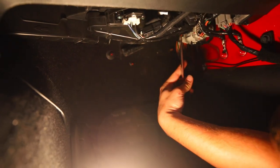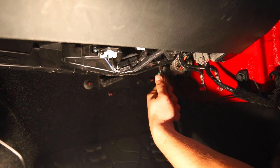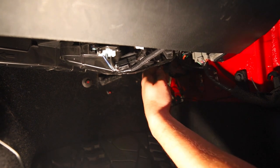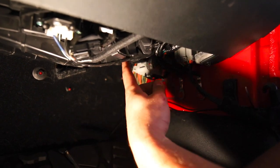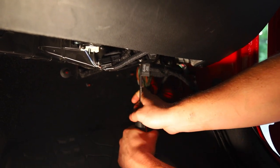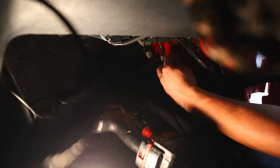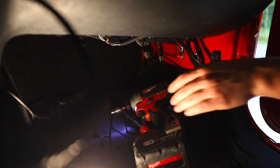Underneath the dashboard where the HVAC blower is, there's a Phillips screw holding the base of the HVAC motor in. You're simply going to take that screw out and screw this to the base of it where the rest of the factory wire harness is. We have an in-depth installation video — it just requires a Phillips head PH2. This is where you're going to relocate your relay. Next, using a 10mm, remove the nut on the factory grounding stud on both the driver and passenger side footwell. Slide our grounding ring terminal on top of the factory grounding ring terminal and reinstall the 10mm nut. All of our grounding points connect to the factory grounding locations.